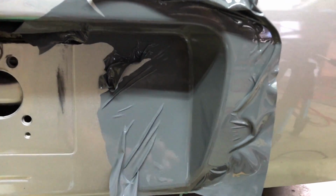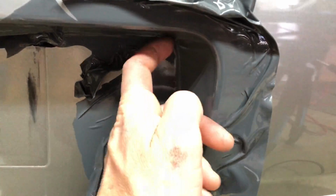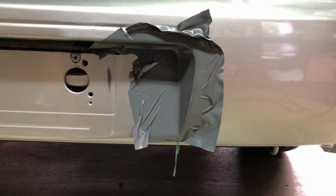You definitely wanna be sure the vinyl is really stuck down to the knifeless tape. That way you have a clean pull. I also learned over this vinyl journey to pull the knifeless tape when the vinyl is cold. You get a nice cleaner cut. Otherwise, if you try to do it when it's still warm, you'll get a gummy type of vinyl. So definitely don't want that.